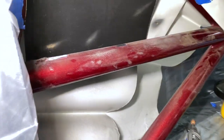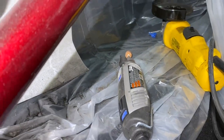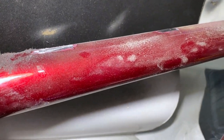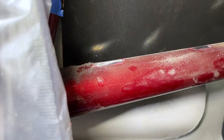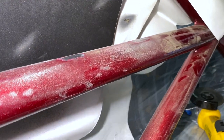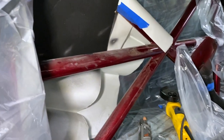All cutting and grinding is done. I used the Dremel cut tool to cut off the harness loop brackets — leaving quite a bit so I didn't dig into the bar — then the big grinder to lower them, then the Dremel to fine-tune. It came out as best as it could. Now it's time to clean up all the metal shavings everywhere and touch up the paint.